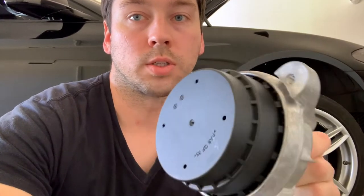It's pretty simple and straightforward. This is important because I've also seen hydraulic engine mounts - you have like a little silver piece, it's like the valve that connects to the hydraulic line, and they have a rubber sheet at the bottom. So it's important to get the right part for your car. Since I'm doing the engine mounts, let's also just do the transmission mount - they apparently are problems more often than not.